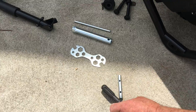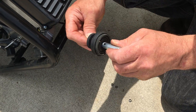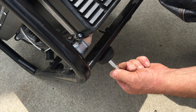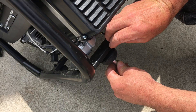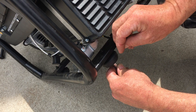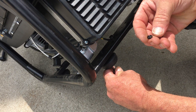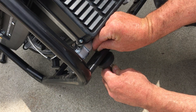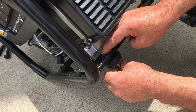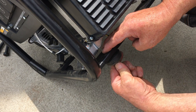It's only a matter of placing the bolt through the rubber buffer like so, and then we'll use the small tube spanner that is supplied. Place the tube spanner onto the head of the bolt through the rubber and place it up through the hole. Now we just pop on the washer, the spring washer, and finally the nut. Hold the nut there with your fingers and just turn the head of the bolt to secure the rubber buffer in place.